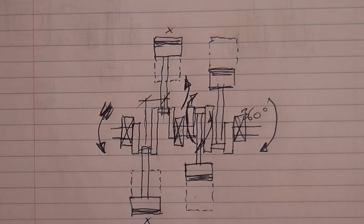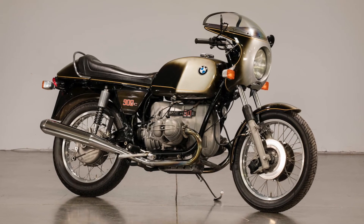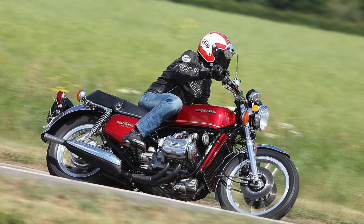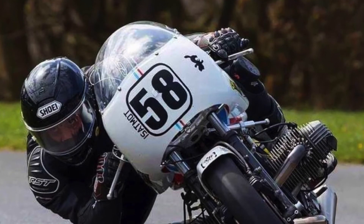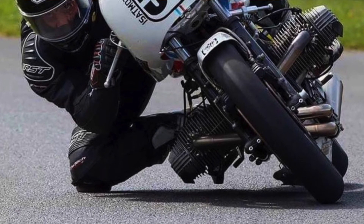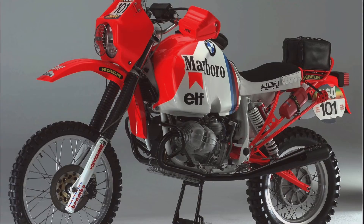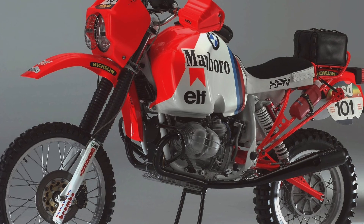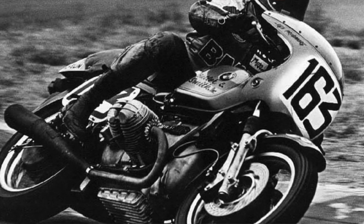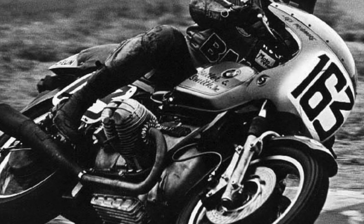The other disadvantage of this arrangement — either as a two-cylinder or four-cylinder — is that it's a very unwieldy shape and difficult to mount in the motorcycle. The best proven way is across the frame, as with BMW and the Goldwing, but it still makes for a very wide motorcycle, though it does give a very low center of gravity. You also have ground clearance issues, so there's a compromise between placing the engine as low as possible and providing adequate clearance. On the plus side, the engine layout with cylinders sticking out each side provides superb air cooling and exceptional maintenance access. The next video will be about V-twins.